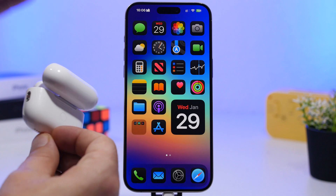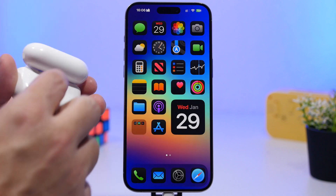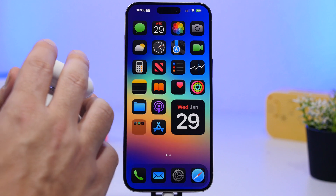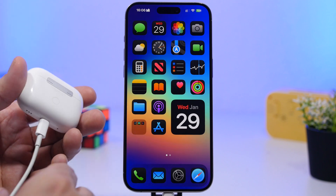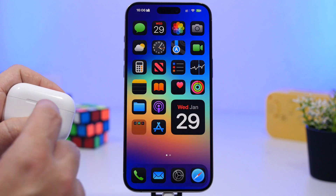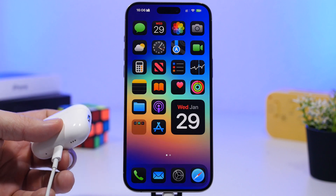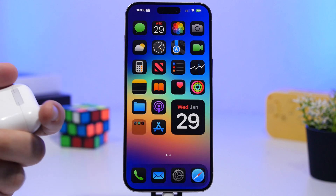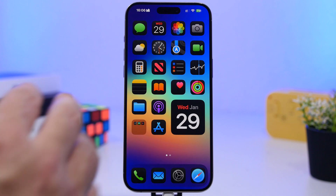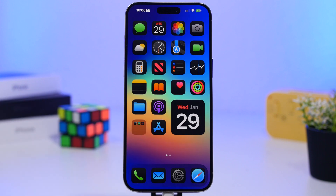That amber flash means your AirPods have been reset. If you have the AirPods Pro 2, which has a button on the back, close the lid for 30 seconds, then tap and hold the back button until you see the amber color flashing, which will then turn white. That means you have reset your AirPods, and then you can try again to update them to the latest firmware. That's basically it for this video — hope you enjoyed it, leave a like if you did, subscribe for more, and I'll see you on the next one.